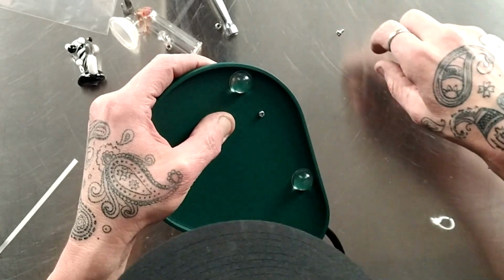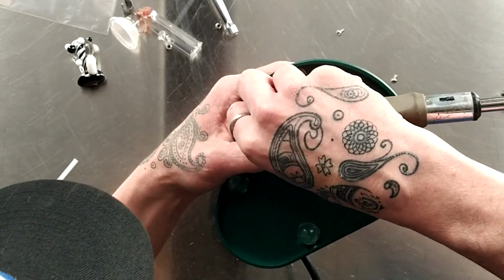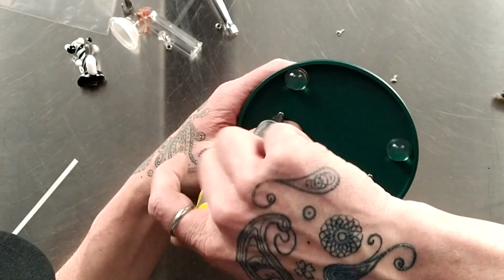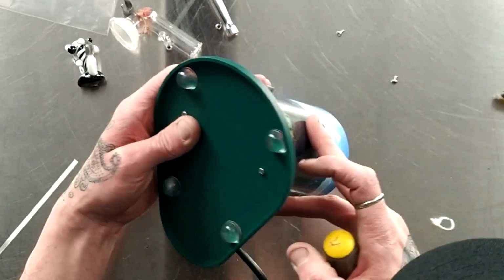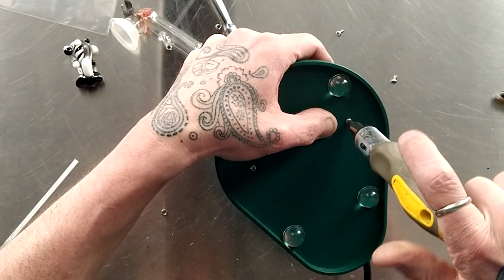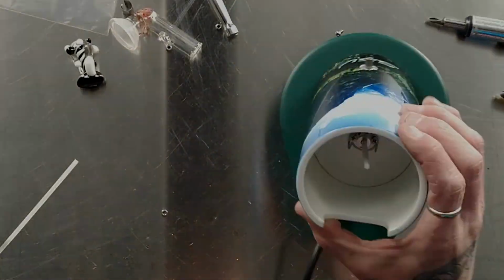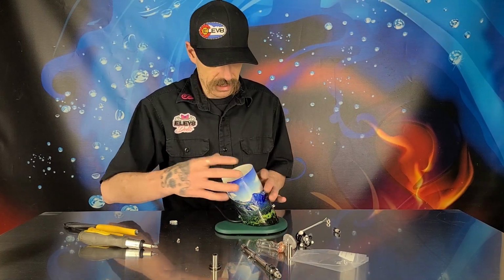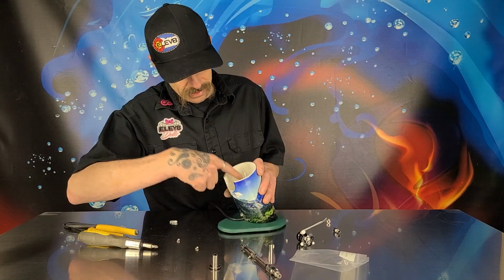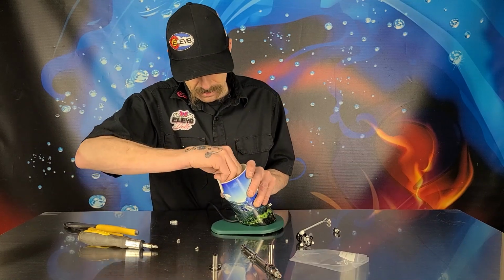If it's tight, you might be cross-threading it. And we'll get the other screw in there. Yeah, I like to press this down. Make sure you don't have any wires coming out of here. Make sure you press that down all nice and tight. Okay, now we're good to go there, and we have a new heater stand in there, and you no longer need this, and this will go ahead and slide in. So you can see right there, it's tight, and I like that. You're going to kind of push and force it in like that, and then twist and push down.